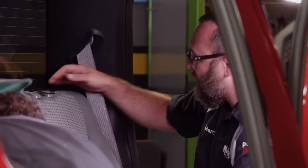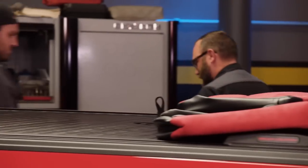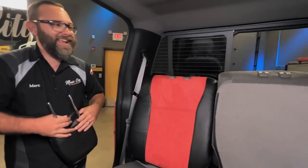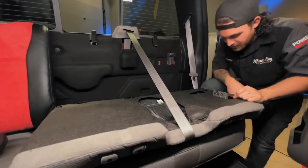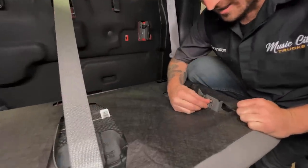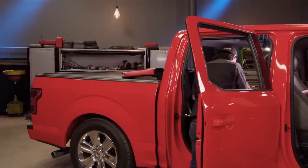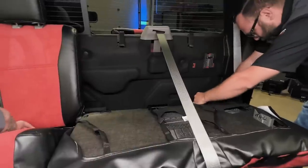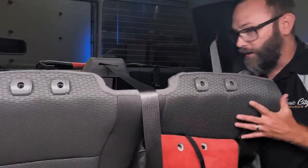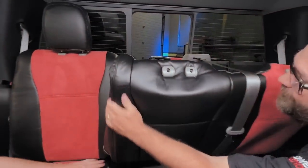I'm at my wit's end with this, Brando. You want me to get that side? I would love for you to come and release it for me. Let me go fix your side — I'll cover your headrest. Ford didn't make this driver's side rear seat back easy to fold down. Is that it? If you've never undone a back seat to a Crew Cab Ford — this little bar — you just push up on that. All you do is that. Here's the way I feel about upholstery: it takes a special kind of person, like engine builders. What's different about these is they're built for the DIY person to install.